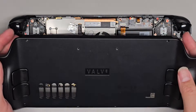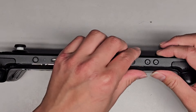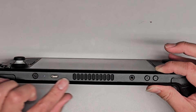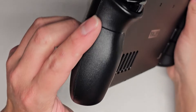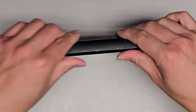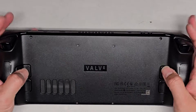Let's go ahead and get the back cover back on now. You start with the top first because that's what we took out last. You're doing everything in reverse. Just lightly click that in — you can see it's flush now — and then just pinch and squeeze it all together. Make sure the lines are all flush there. Down here, you'll want to pinch that all in as well. And you can test these buttons — feel good.